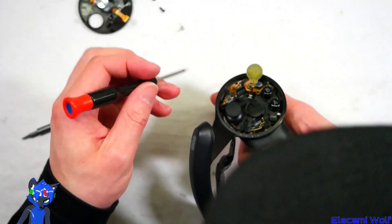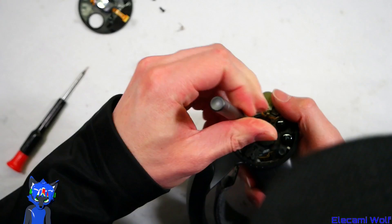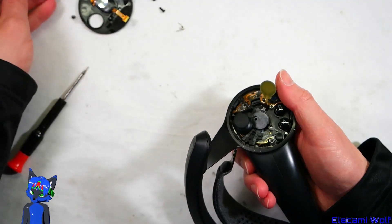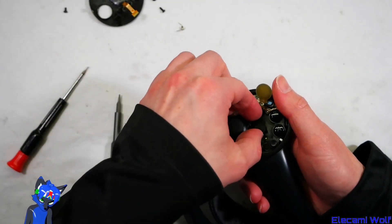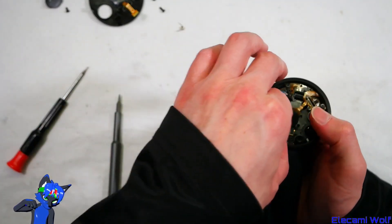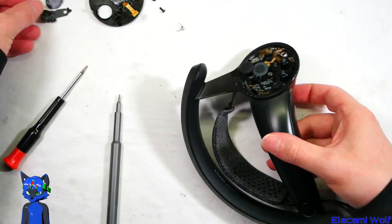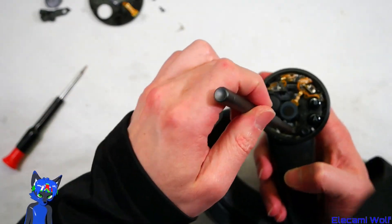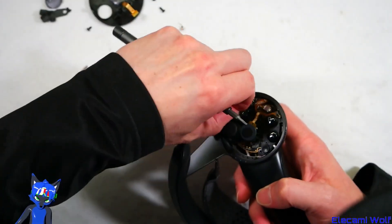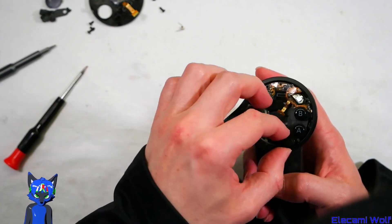That can just hang there out of the way — it can be unplugged with a very tiny plug. That now exposes a screw that needs to be undone. That's a non-self-tapper style machine screw. The center piece comes out and then the strap adjuster comes out too. Now we've got one, two, three more machine screws to undo. Alright, all the screws are done and this assembly is now loose.